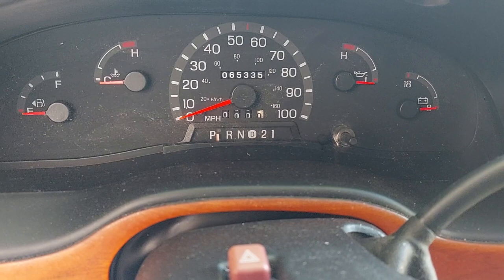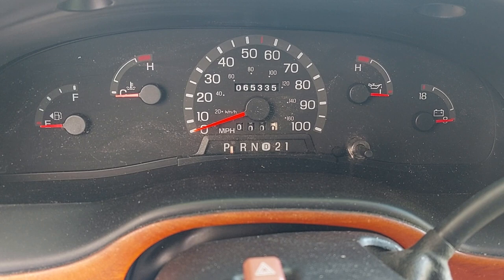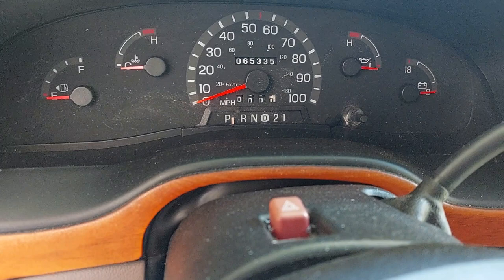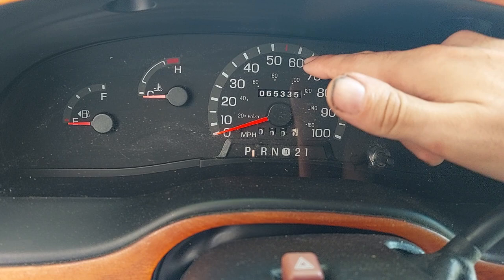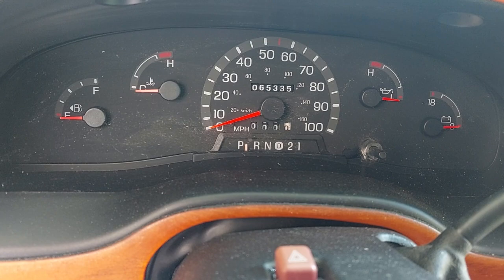The other day I was driving my kids to the bus stop and I realized the tripometer and the odometer were not moving. I did some research — it is a common issue with the 1997 and 1998 Ford E-Series, F-Series, and some other Ford products that had mechanical speedometers. There is a motor with a gear attached to it behind the cluster which controls the tripometer and odometer. What happens is that plastic gear wears out and breaks, the motor can't turn the numbers anymore, and your vehicle stops tracking mileage.